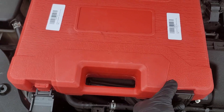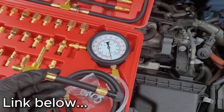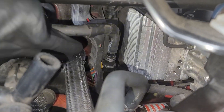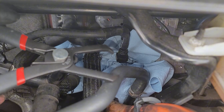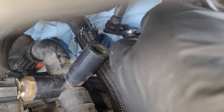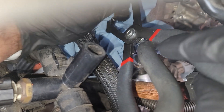Here's how to use this fuel pressure gauge to check the fuel pressure on a Toyota or Lexus with quick disconnect lines. First, make sure to put some cloth below the fuel line to catch any fuel. Then use these push pin pliers to push down on both sides of the connector while pulling up in order to remove the fuel line.